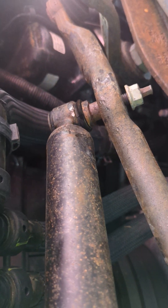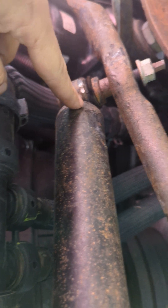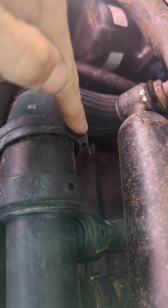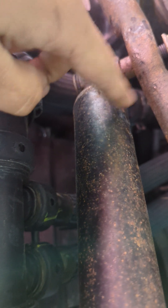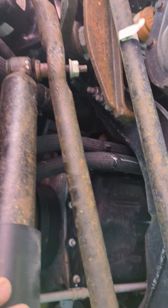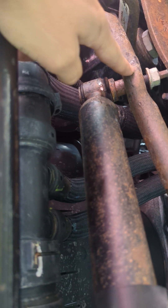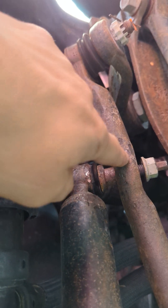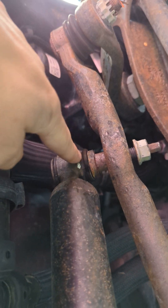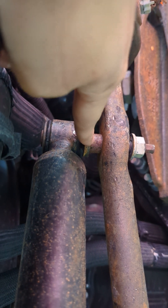I didn't have time to go get the fork, so I hit it with the hammer right here. I'm going to change this part anyway so I don't care if I damage it. Be careful not to break the plastic — do this carefully. I hit it four or five times, pretty heavy. It's easier if you lift the truck, but I didn't. A tip: if you hit it in the middle, right next to where it's sitting rather than at the part itself, it loosens up every time — it works on ball joints too.